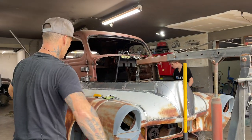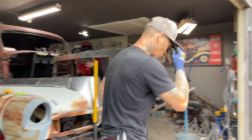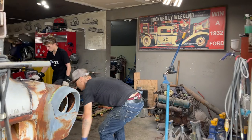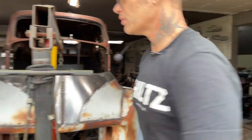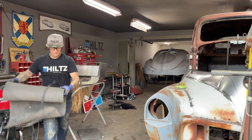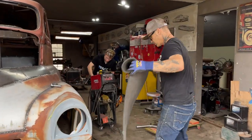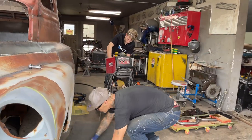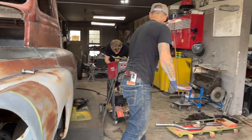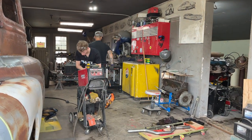I'm going to get my glasses on and clean up a couple ends of this so we can get a grind. What we're going to do is tack this to one side of the chassis, tack the other side, just put it underneath the oil pan and let it sit there. It has to be welded fairly decent, and it's going to hold the motor up. So if it breaks while we're doing something, the engine would flop back and hit the firewall and do all kinds of floppy chicken things — and we don't want that.